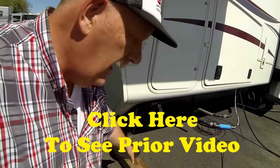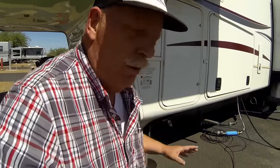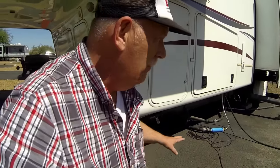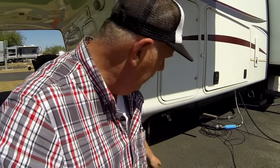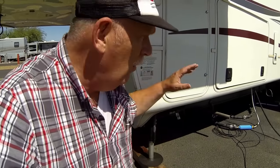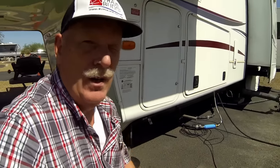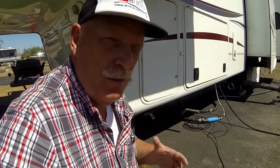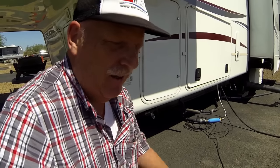What I wanted to show you is that the Montana has a hydraulic lift system for the leveling. So when we were stranded on the side of the road, one thing in our favor was we pulled off far enough to be in gravel. You can see I'm on concrete right now. What we did is we double-blocked one side of the RV and then used the driver-side controls to lift only one side, which with two four-inch blocks under there allowed us to get the tire barely off the ground.